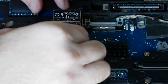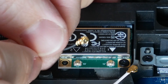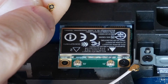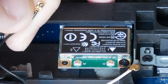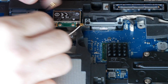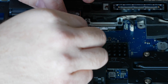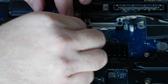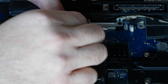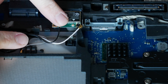And now we just go ahead and reattach the wires. If you look at this — I'm not sure how clear this is on the camera — but you can see it basically has this tiny little circle on the inside, and that's where that tiny little pin fits inside. You've got to be careful when you're putting this back on. You want to have it right on top before you apply any pressure so that you don't bend that pin, otherwise you're going to have to replace it. When I apply pressure, I just wiggled it back and forth and it clipped right into place.